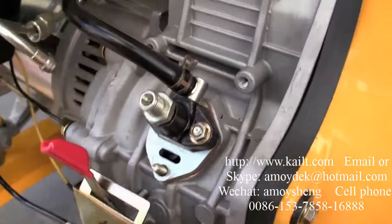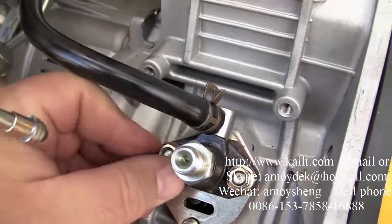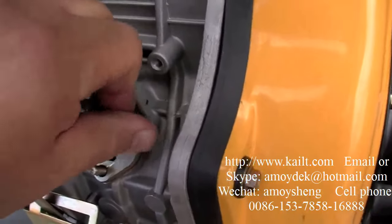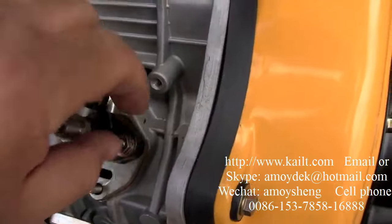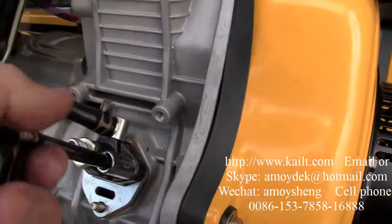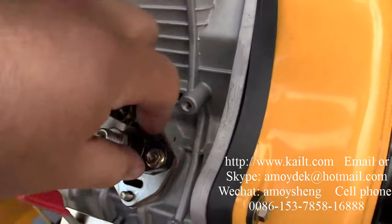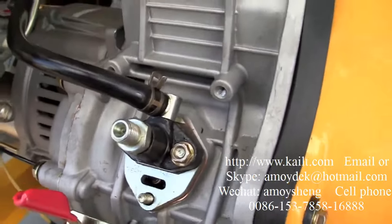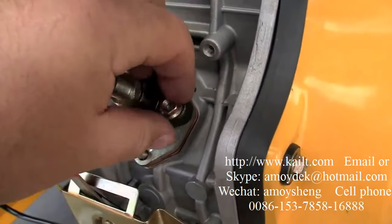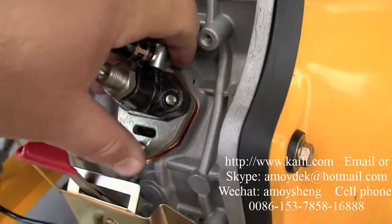The engine speed is directly proportional to the amount of fuel this pump pumps. When it pumps is the fuel injection timing. That's determined by how close this fuel pump is to the camshaft that makes contact with it and causes a plunger to move and pump fuel. The closer it is to the engine, the sooner it's going to pump. The farther away it is, the later it's going to pump. That space is critical, and the shims underneath here that we're going to see determine when this contact happens. And believe it or not, these little tiny shims underneath make a huge difference on fuel injection timing.